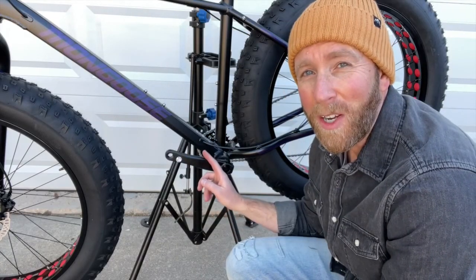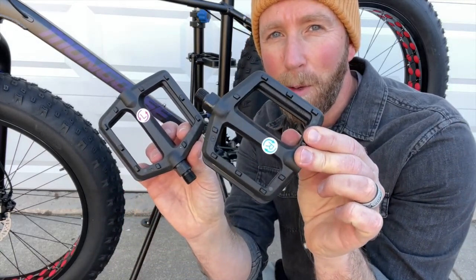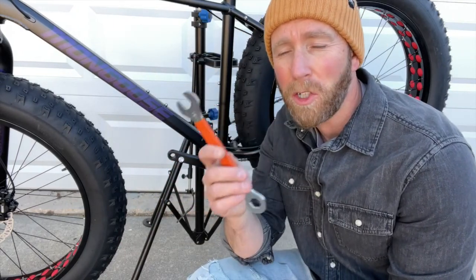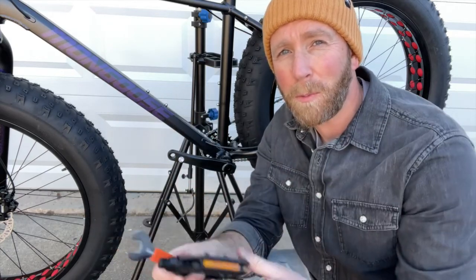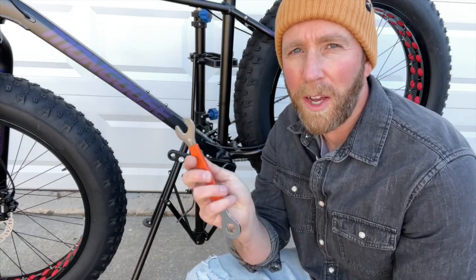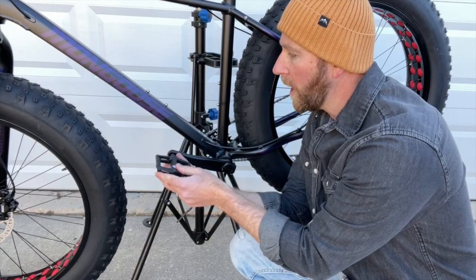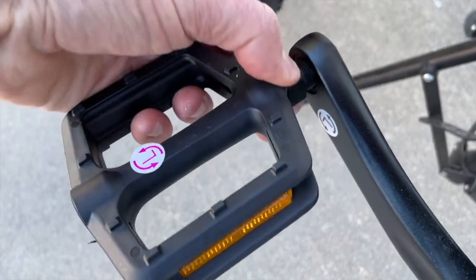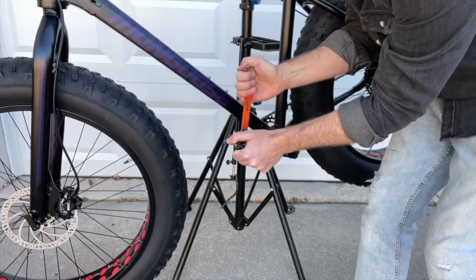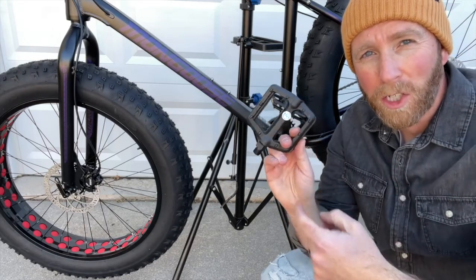Okay, it's time to get the pedals on. Now these are nice because they're labeled correctly in the way that you need to spin and tighten, and also labeled so you don't get mixed up. Let's start with the left one. One of the things that can really help with the tightening process is a pedal wrench — you can find these on Amazon, we'll put some links in the description box below. If you've got a 15mm regular wrench that'll work just fine as well. Using our fingers first, I'm gonna put the left pedal into the left crank and twist counterclockwise to get this into place. You can do most of this with your fingers first and then get in there with the wrench. Once we're done with the left side we can repeat the process with the right — just remember you're gonna go in the opposite direction with the right pedal.